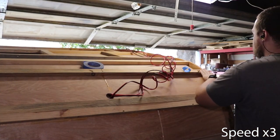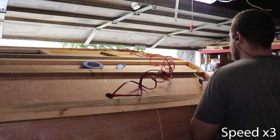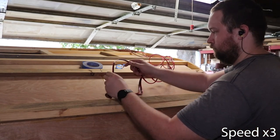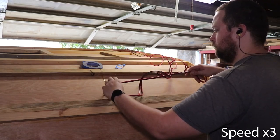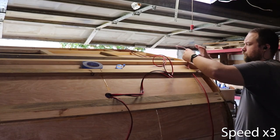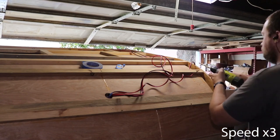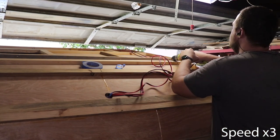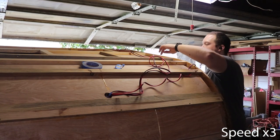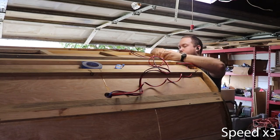through the roof. Okay, so what you see here is the couple of wires that we pulled through to the front of the camper. That's the plugs that will go into the living cabin or a sleeper cabin, as well as the 12 volt that will be in the galley. The goal here is just to run them through. Each one gets its own individual path through the ceiling spars, and I wanted to run those from the right hand side. I'm really just making sure there's enough space between the wall and the first hole, and then pretty much giving myself about an inch and a half for each hole next to it.